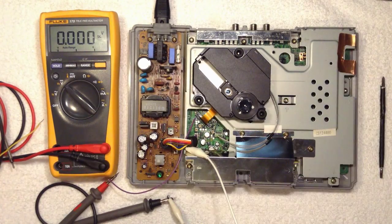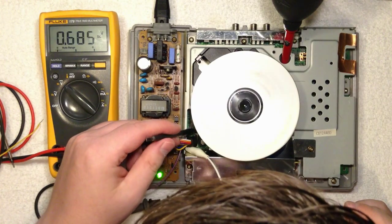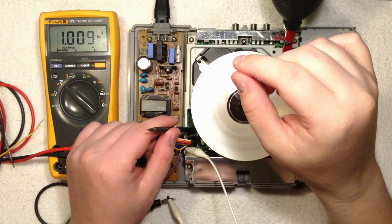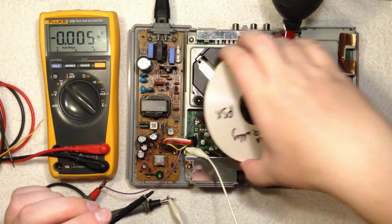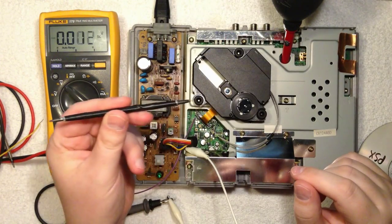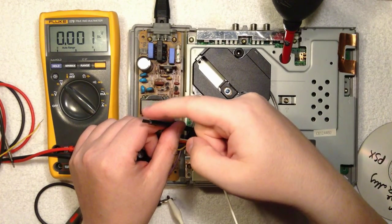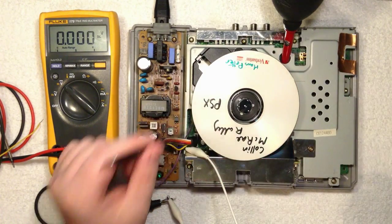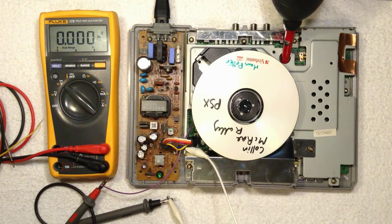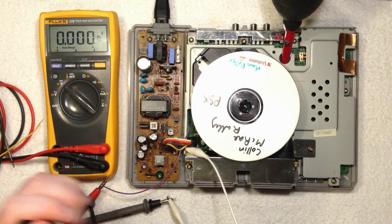Okay, I will use a backup disc here. I have my screwdriver here, and when I touch the bias knob and this part, which was not insulated, it starts making noise. I'm probably picking up my 50 hertz, or in your part of the world maybe you have 60 hertz, from the light network or the mains. So yeah, that was a thing I didn't like.